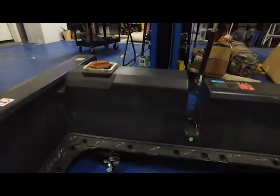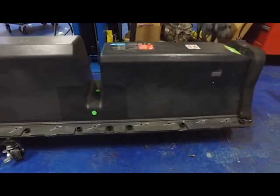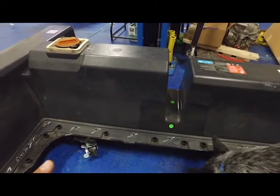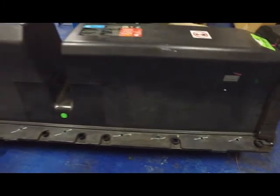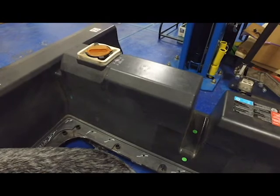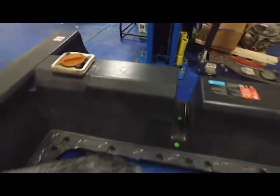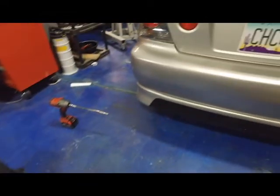As you can see, a whole bunch of bolts — again, all 10 millimeter, nothing special about them — and I'm just going to discard them. The only thing those do is hold the top, which is some sort of composite fiberglass and plastic, to the steel base plate. Keep in mind when this is in a Volt, this actually is the floor of the vehicle. The back seats would sit right here, with the person in the back seat literally sitting right here, facing forward. So this would be forward in the vehicle.